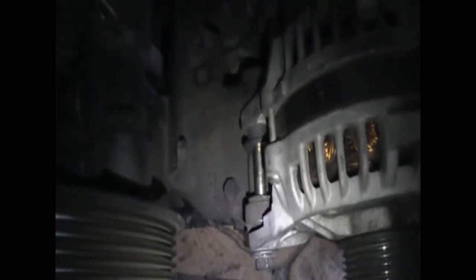You can see the alternator is fitting there — that shaved part will bolt back and pull the back part flush. The problem I'm having is with the top part. The bolt sits on this raised section which is not letting it get past the mount. I'm going to look under the van to see if there's a way to adjust that top mount from the other side — maybe loosen the bolt, get the alternator into position, and tighten it back up. Looking from the back, there doesn't appear to be an adjuster there.